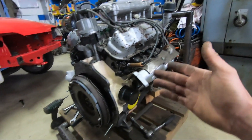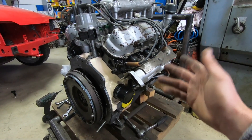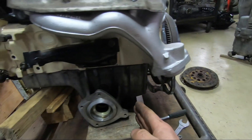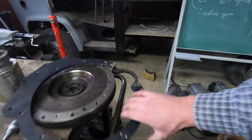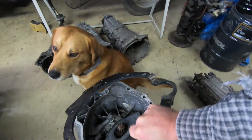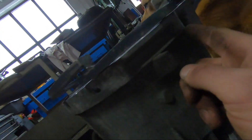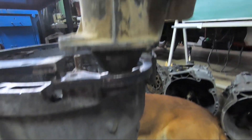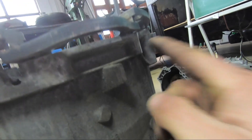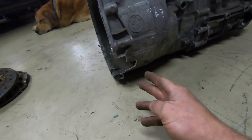I've been using the kit for two racing seasons without a single problem. Because of the flywheel offset, we need to move the starter motor too. That means making some space for the original Ford starter motor towards the gearbox — we do that simply by cutting a little piece out of the bell housing here. We take the adapter plate, mount it in position on the positioning pins, see how much they interfere, mark it, and just keep cutting away until we clear the starter motor on the bell housing. A very simple solution but it works great.